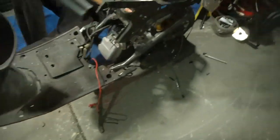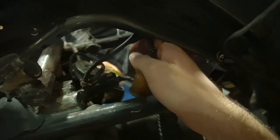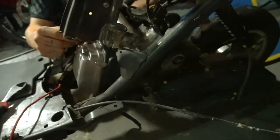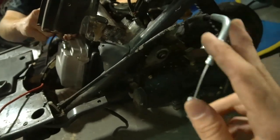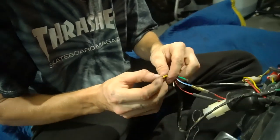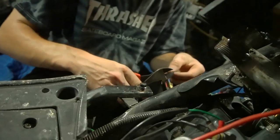Alright, everything's welded together for the frames. Now we're back here — I just got the brake all hooked up. Been hooking up some of the fuel lines, he's over there messing with some of the wiring. This thing should just be plug and play because this scooter already had a running harness with a 150 GY6. For now we're going to run the throttle off the back scooter, but we plan on coming back after we make sure it's actually running and good. We got to make the throttle cable longer so the front person has the throttle. It's a little MacGyvered over there — a lot of mix up. Seems like most of the problem with Ray's moped head was literally wiring. I think we'll have this thing started tonight — no exhaust so it's going to sound like a boat mobile.